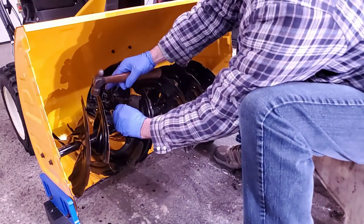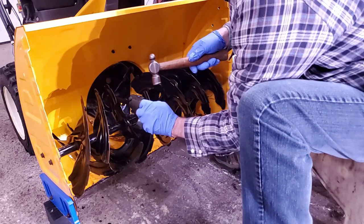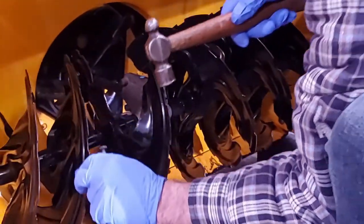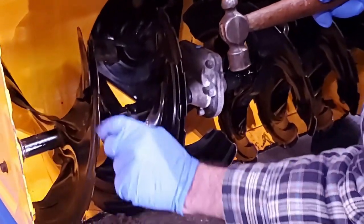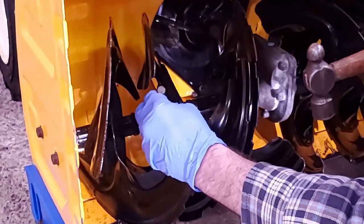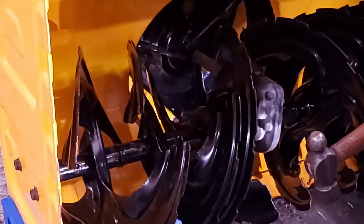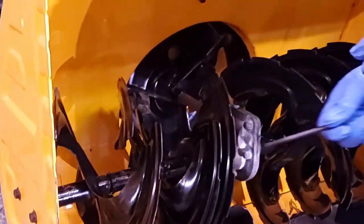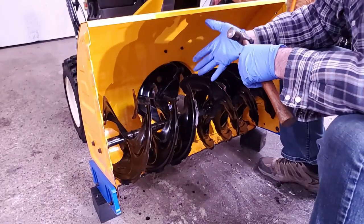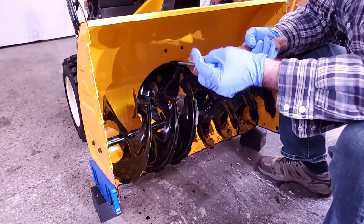Let me give it a shot. It's been two days — I've been on and off with penetrating oil. One thing you can't do on this: you can't put heat on it while it's in place because there's plastic bushings in every one of these. If I put heat on that without taking this entire thing apart, I'm going to melt everything, and then I'm going to have to take it apart anyway, replace the bushings, and it's going to cost that much more.